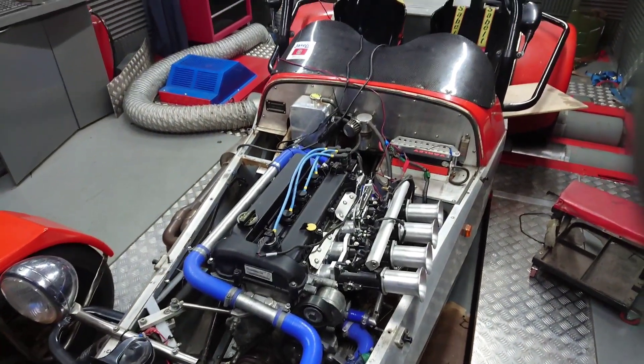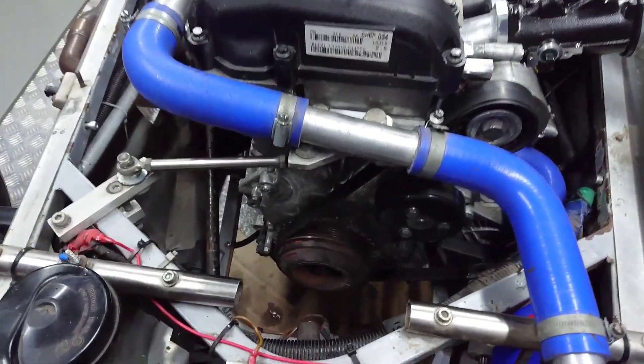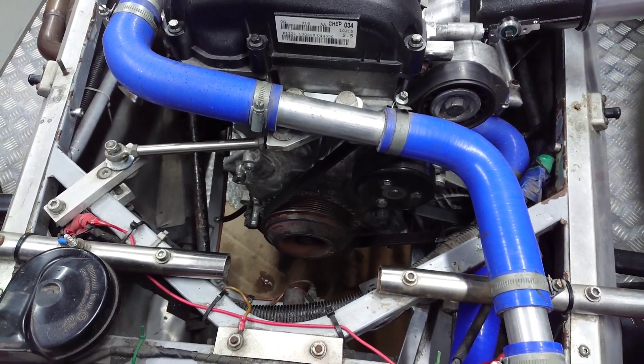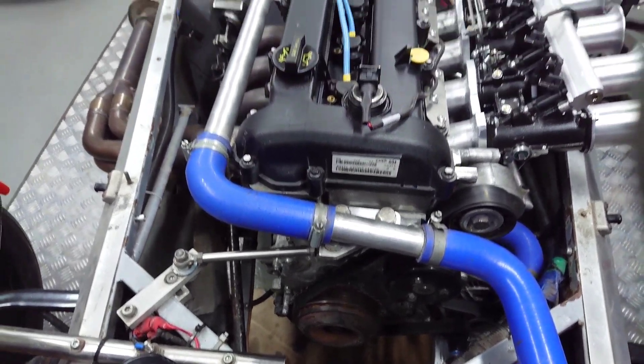It's been an interesting conversion. There were actually a couple of little complications we weren't aware of. We put the front pulley on from the 2 litre and then realised the crank sensors are different, so we had to take it all apart again, swap all that over, put the 2.5 pulley on and put the correct sensor on there. But aside from that it's been pretty straightforward.